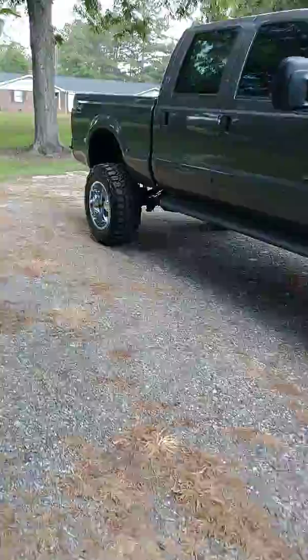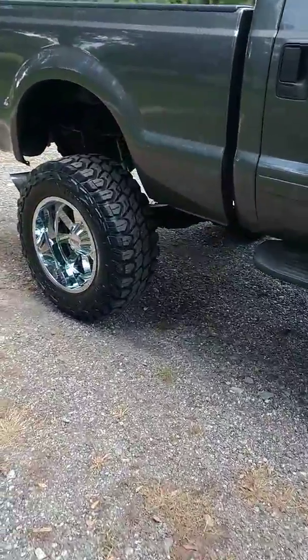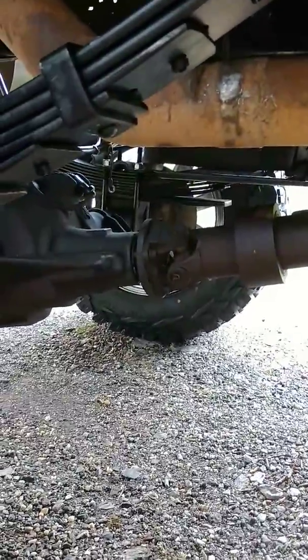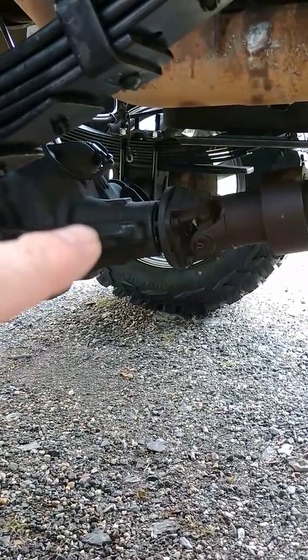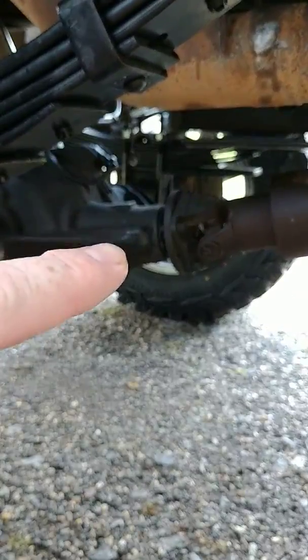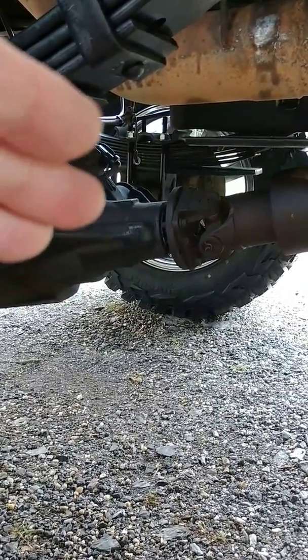To give it a real quick review, I do have one issue with this truck that I'm still trying to iron out, and that is axle wrap. I put the carrier bearing drop kit in it — you can't see it from this angle — but what's happening is, I talked to Rough Country's tech support. When I accelerate, this thing is wrapping.